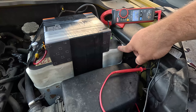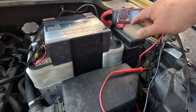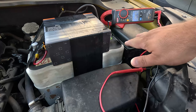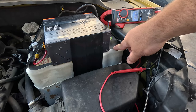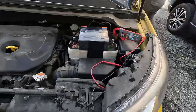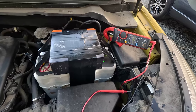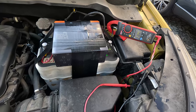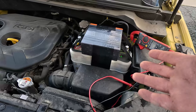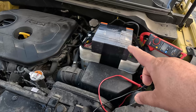This isn't really pulling any power because 150 milliamps is the normal sleep-mode draw for this car. Even if it's blipping to keep itself topped off, it's not very often, so I don't think it'll be a problem. Let's have my wife start the car again to make sure it's still good after two hours. We can see the initial power draw from everything turning on, and the car starts right up. 13 amps max on the lithium iron phosphate battery — this unit is perfectly fine. It runs for about 30 seconds to retop everything back off. The next step is to leave the hood popped and let this sit overnight to see if it's still sitting at around 13.2 volts by morning.